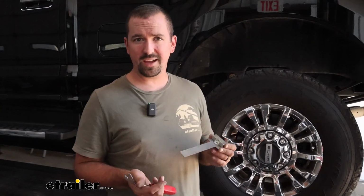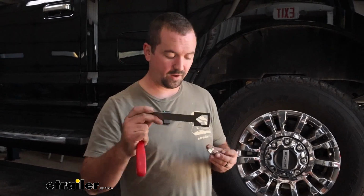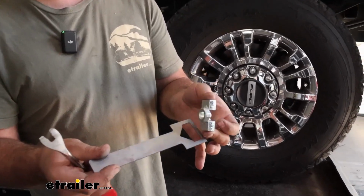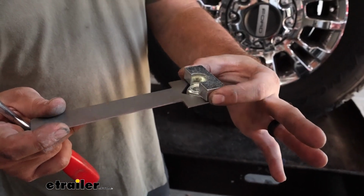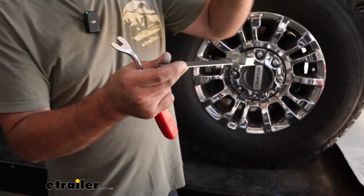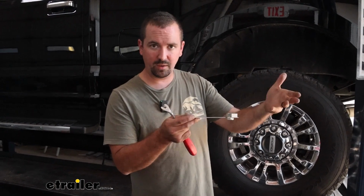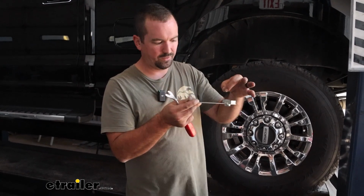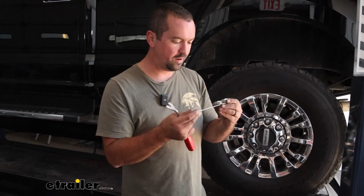The bolts that we passed down with that split washer, we're going to be using the tool that's included with our kit, as well as these spacers with the nut welded on. And we're going to place it with the spacer towards the front and the nut portion dropping in. And this is going to feed into the corrugation, and as we tighten that bolt down, it's going to thread in, so it may become a two-person job. I think in the instructions they might have had you do this first to see if you could thread it in. You could probably still hop up and get that threaded in, no problem.